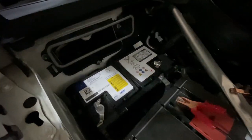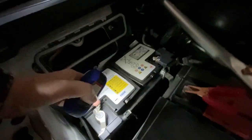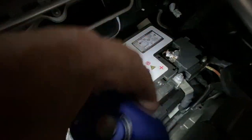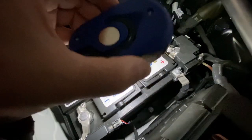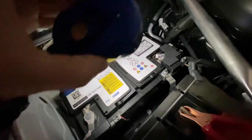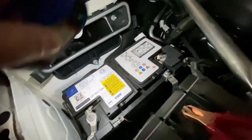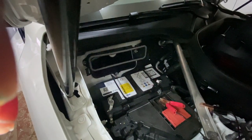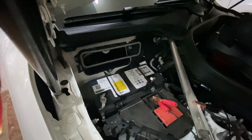To unhook the battery it's very simple. You've got a 10mm on the negative side — I'll take that off first — then 10mm on the positive side. And then a Torx 45 way down on the bottom front of the battery, holding a bar that actually secures the battery in place. So I'm going to unhook the two terminals, take out the Torx 45, and this battery with its two handles should lift right out. This is the factory battery, about four years old.